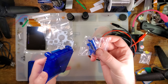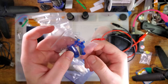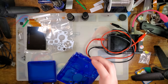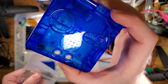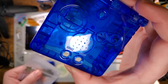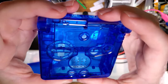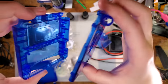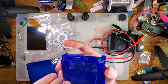Anyway, the shell comes with the pretty standard affair of accessories. Unlike the prototype I checked out, this one actually does have screw covers, and hopefully some of the other issues I pointed out are fixed. I suppose we can quickly eyeball that. It looks like they've made some pretty significant improvements to the speaker grill itself. I can still see some of the weird mold lines, flow lines of the plastic left as it was flowing around the holes in the mold. But unlike the prototype I have, the plastic is fully filled. In the prototype, there's chunks of material missing where the plastic didn't flow well enough.